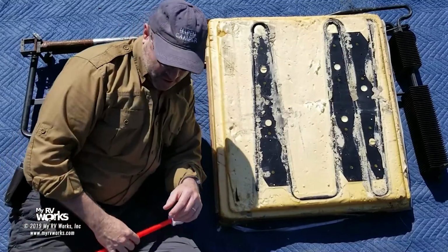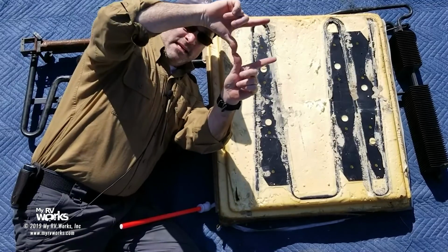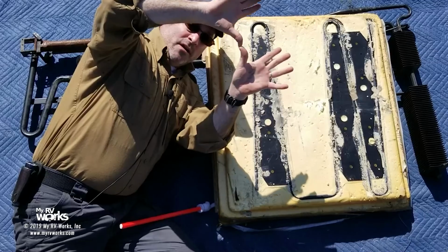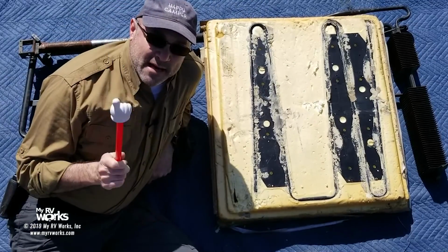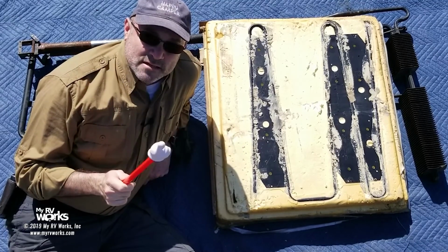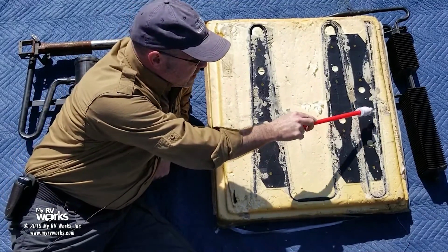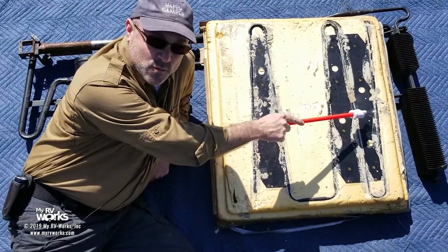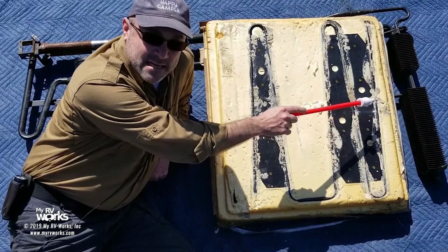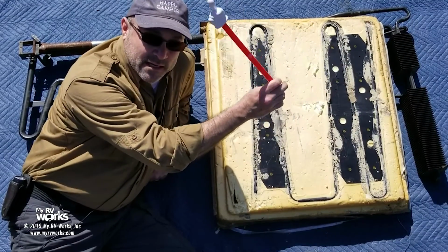And if you look inside your freezer, you're going to have like this C shape, this heat sink thing. The roof of your freezer is metal, the bottom floor of your freezer is metal, and the back wall is metal. With me? But anyway, that metal acts as a heat sink. So your ice cream, your chicken, your broccoli, your cold frozen peas, all that stuff touching that metal surface is actually touching this metal surface. And this metal surface is the one where the ammonia is doing the evaporation. So if there's evaporation taking place, it's taking the heat with it. We're going to get into that even more. I keep teasing you guys, but we're going to get into that a little bit more when we do the breakaway.